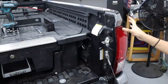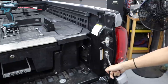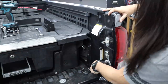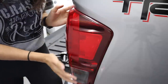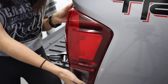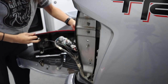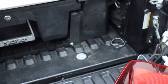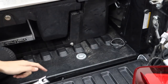First step is we're going to remove the tail light. With your tailgate down, remove this bolt and then these two bolts down here — they're all 10mm bolts. Then to remove the tail light, grab it at the bottom and top and pull straight out parallel to the truck. Next, we're going to use our breaker bar and a T55 socket to remove the OEM bolt that bolts the bed down. We're also going to break the bolt which holds an OEM tie-down point.